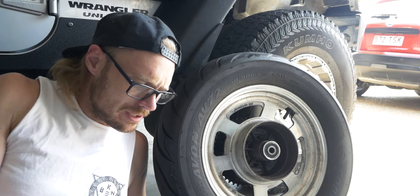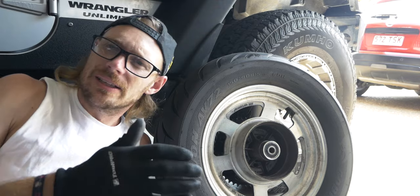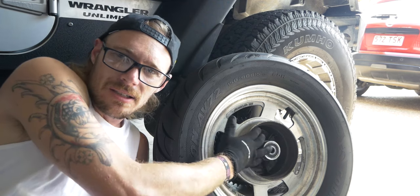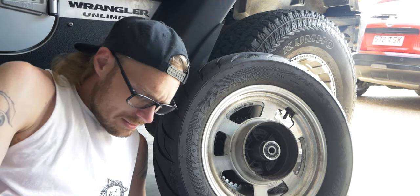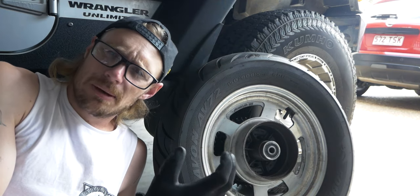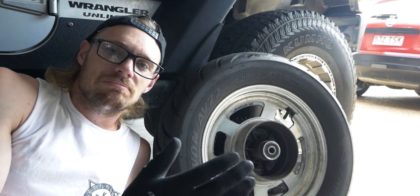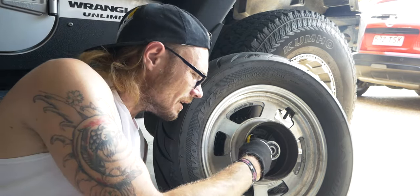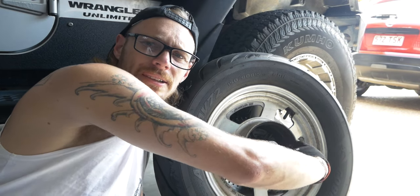I had a coffee and failed at the timelapse. Now we're going to quickly address the rear brake squeal issue before reassembly. My rear brakes are squealing like mad whenever I put my foot on the brake, especially when the bike is cold. It's a dust-related issue you get with drum brakes — there's a cover over the drum and nowhere for dust to go as the pad wears. We'll give it a cleanup with brake cleaner and a bit of emery tape to roughen up the surface. People often think brake rotors and drum brakes should be smooth, but you actually don't want that — rough surfaces grip better and squeal less.